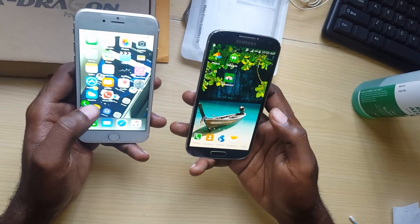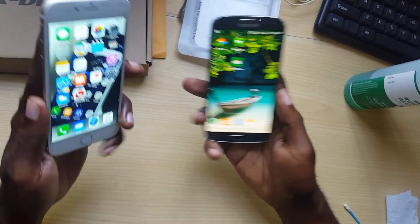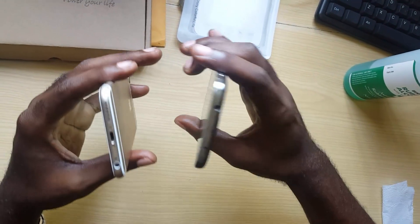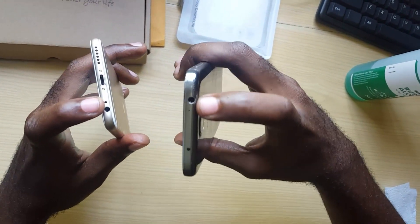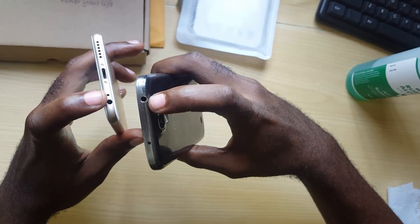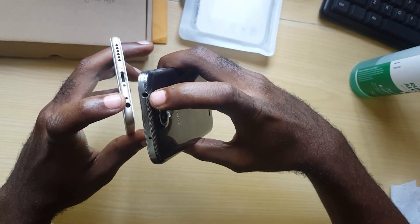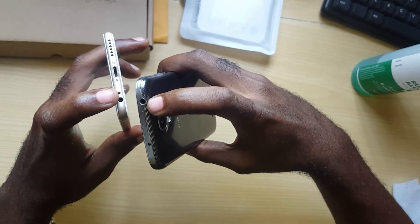This includes the S5, S6, S7 and so on, and also on the iPhone 6 and 6s. The reason why you're seeing headphone connected when there's none is because of something that happens with the ports on these phones — the iPhone headphone jack and the S4's headphone jack. Sometimes moisture, dirt, or lint gets into this port, and when that happens the phone is tricked into believing that there is a headphone connected.